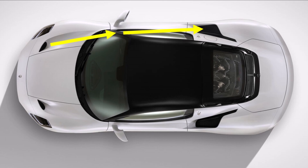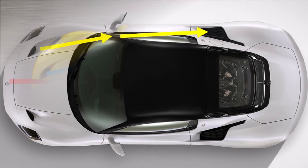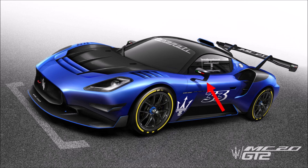But this concept is already not ideal at the road car. If cars use a roof scoop you would usually split the front exits to leave a clear path in the middle. The side mirrors have a stay outboard to not disturb the flow close to the A pillar, and the alignment can help to guide the losses away from the inlets.